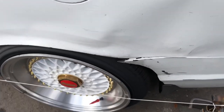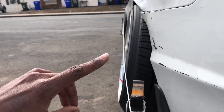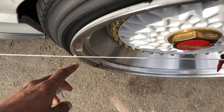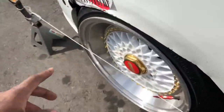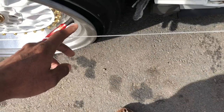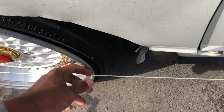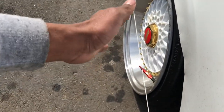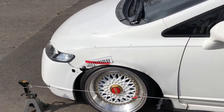From what you could see, I got the string going straight down the car. So what we're looking for — you see how this side has no space? Both sides had no space. When we get down here to the front, you see that I have too much toe out, because the string is touching over here but it's not touching over here. So I gotta adjust the tie rod ends and bring the toe in a little bit. That's what I'm about to do on this side, and hopefully it works.